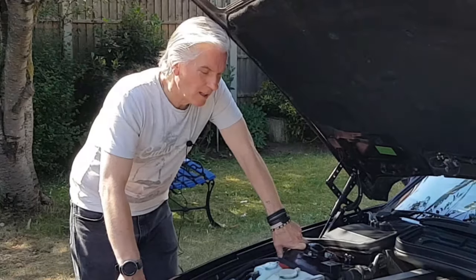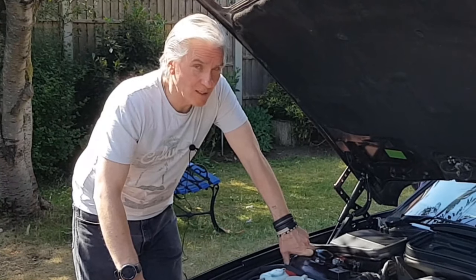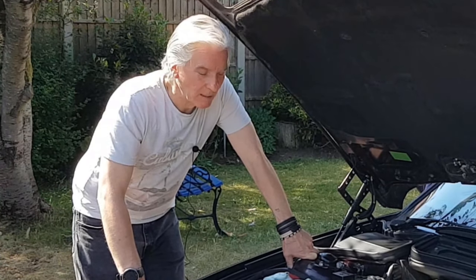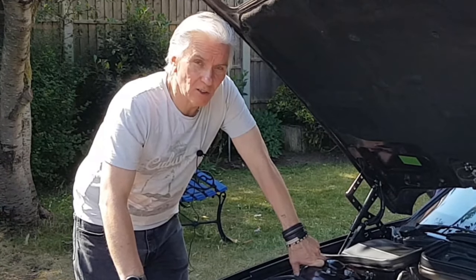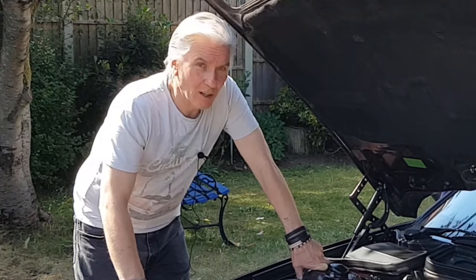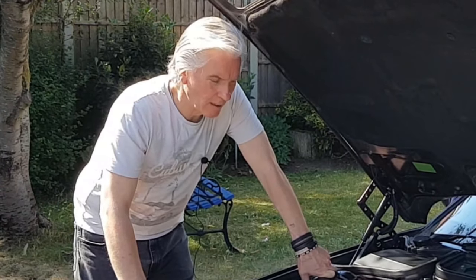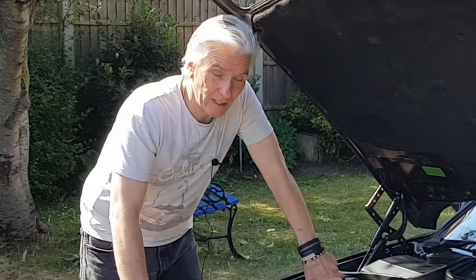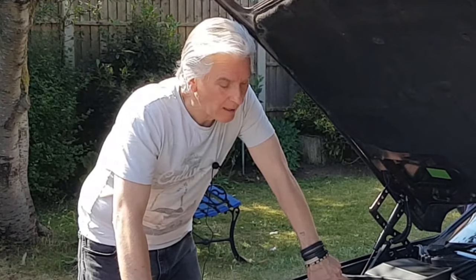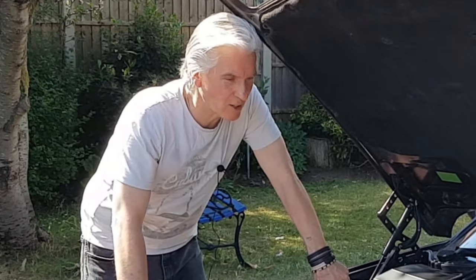And talking of timing, it brings us onto the reason why you always get camshaft A over-advanced as a good warning of timing chain guides failing. Well, it's not an advance warning of timing chain guides failing; it's an advance warning that your tensioner isn't working. I'll draw it out a little later on the whiteboard and show exactly why you get that error code. But that's a great sign: timing chain, camshaft A over-advanced, change your tensioner, change your oil immediately. And also we need to change the tensioner in such a way that it builds up pressure before the engine actually starts.